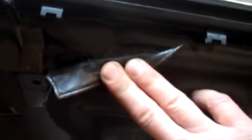The vapor barrier is actually held on by what we often refer to in the shop as dum-dum, which is like this black tarry adhesive, also known as butyl tape. So you can see the black tarry stuff there. Now this is a way to get this off where you hold back and then use a sharp razor blade just slice along the butyl tape.